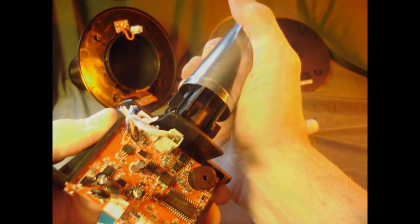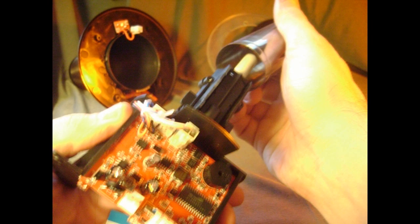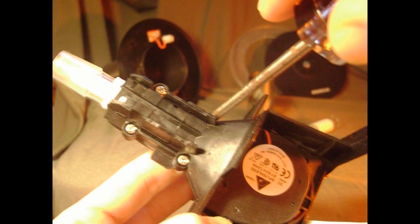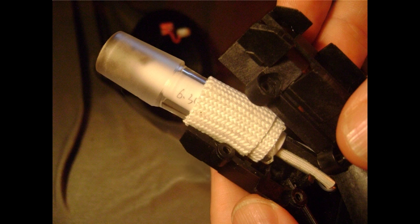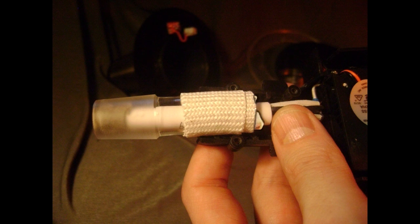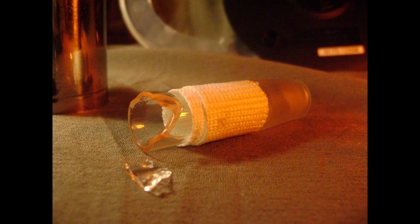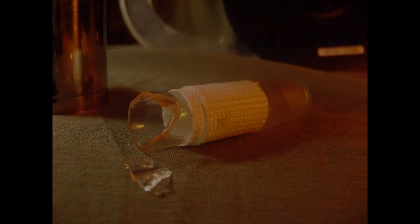Next, you're going to want to pull the tubular stainless steel collar that surrounds the glass heater cover assembly straight up, removing it from the center mold. Now you can remove the 4 screws of the cradle housing that locks the glass heater cover into place and remove the cover, being careful to avoid spilling any of the broken glass that may still be trapped inside. Once it's opened, you'll see your broken glass heater cover inside. Now remove the glass heater cover by pulling straight up and clean out any broken glass particles and debris from your Extreme Q. Some canned air can be helpful for this.